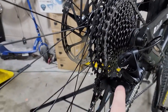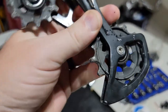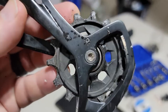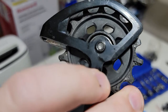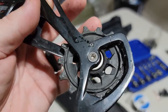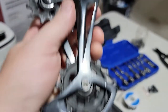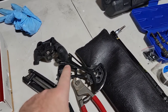What prompted me to finally go ahead and replace this today was I bought replacement jockey wheels for it, and darn it, that thing didn't just round out the first time I tried to remove it with the right tools. Rounded out, couldn't get it to budge — tried penetrating oil. Finally tried drilling it out with the easy-out set and I broke three drill bits on this stupid thing. Then I tried drilling it from reverse with carbide — kept breaking drill bits. So I was like, yeah, we're done. These are pretty worn out; they don't actually have bearings, it's just plastic sitting in those little cups. I decided I can't change that out, I'm just going to get rid of this. It's done. That should be one of your first upgrades.